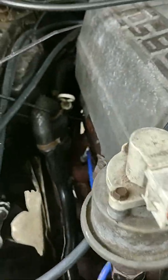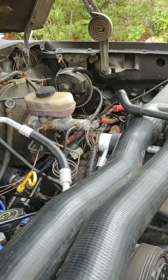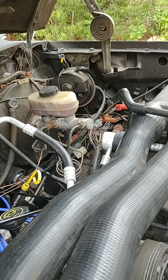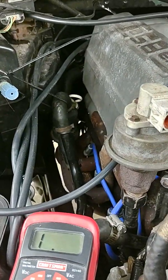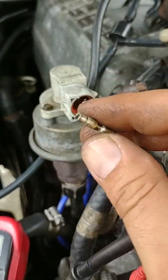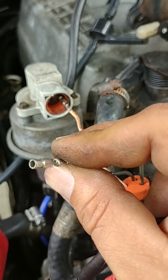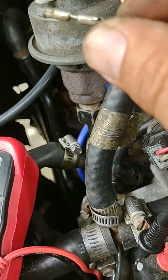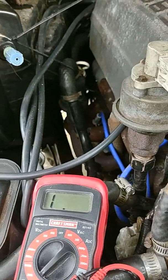Now if I go and do a continuity test between here and the pin out over there, see I got the plugs unplugged, it comes up good. So it's not the wire itself. Somehow just this connector right here is no good. But look at it. It's in perfect shape. There's nothing wrong with that. How? I swear, these sort of things only happen to me.